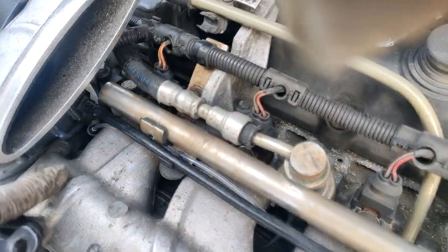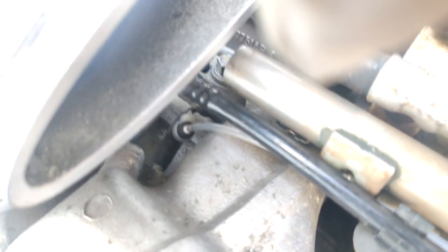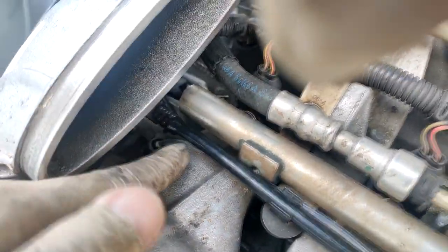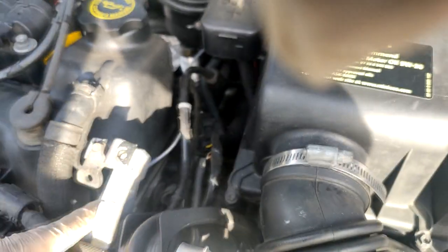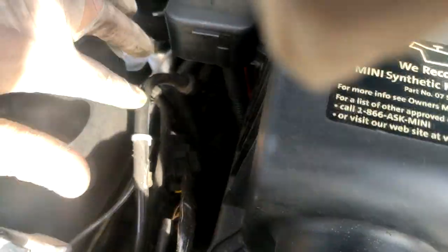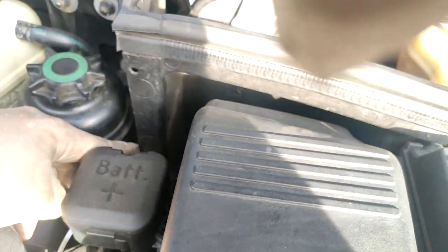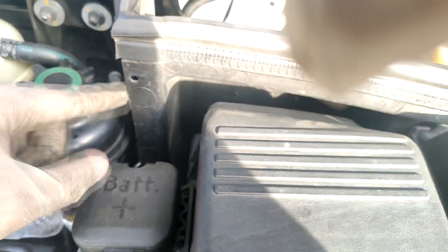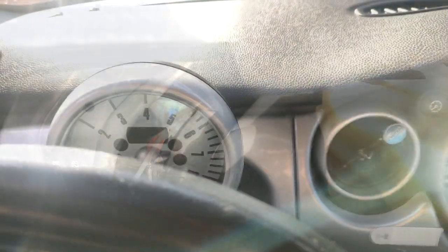As you can see, the vacuum line starts from here. We connected a rubber T connector right there, and the outlet runs parallel to the fuel rail. I slipped it right underneath the intercooler bracket and ran it alongside the fuel purge vent line, slipped it behind this plastic piece, and the line goes right into the rubber grommet for the power cable. It comes out the other side of the firewall, and from there we'll feed it through the steering column up to where the gauge will be.